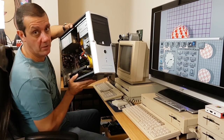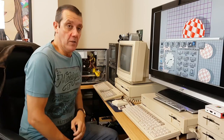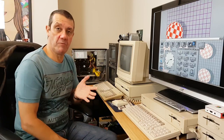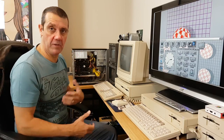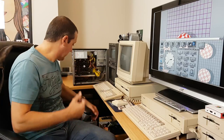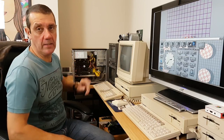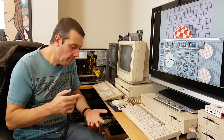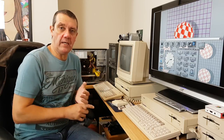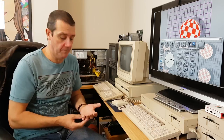Hopefully some of this information is going to help you with whatever you build — that's the idea of Part 2. I'm going to be covering things that I possibly won't even do myself, but let's go to town on this. The first thing was the hard drive. In there is a 40 gigabyte IDE drive, and the issue with AROS at the moment is it cannot use the latest SATA drives.